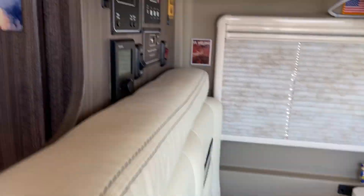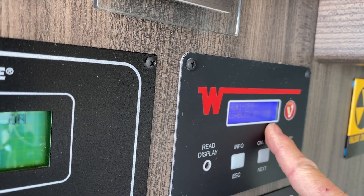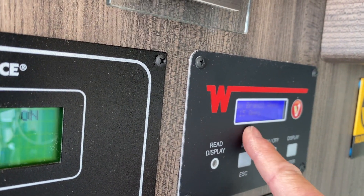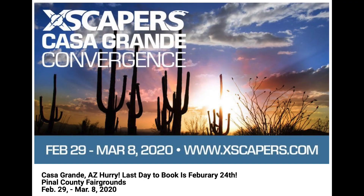Now let's verify it's running. The display shows 'disabled by jumper' — that's what we want to see — and 15 amp branch amps. That's great. So there you go: that's two hours to charge from 75% to 100% using 15 amp service. Not surprisingly, that's significantly longer than using 30 amp, where I've seen charges run much faster. I don't have many energy draws going on right now, but I'm pretty pleased with that. I'm going to stay plugged into 15 amp service throughout the convergence.